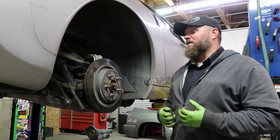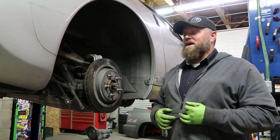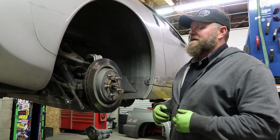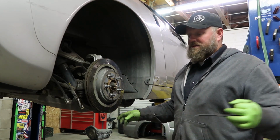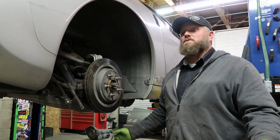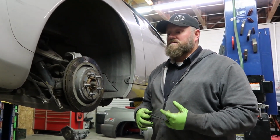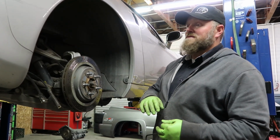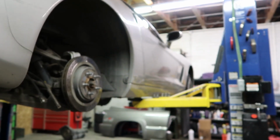He had it towed in. We fired it up for, you know, 2 seconds. It didn't have any oil pressure and it was rattling. So shut it down, started tearing the motor apart, and took the valve covers off. And the top of the motor was okay. Everything was still intact. Rockers, push rods, the things that you can see, springs were all there. And drain the oil, and when I was draining the oil, it looked like the prettiest silver metallic you'd ever seen in your life. And it was all because of bearing material.